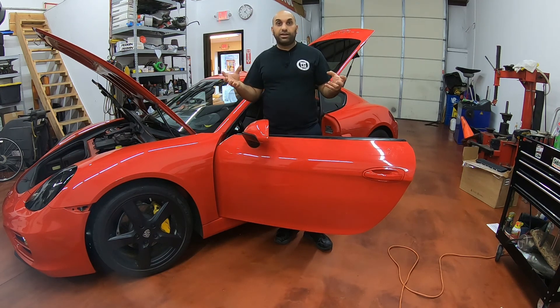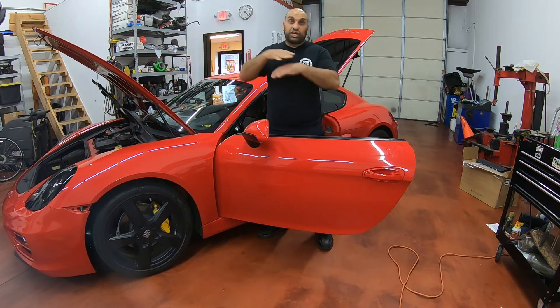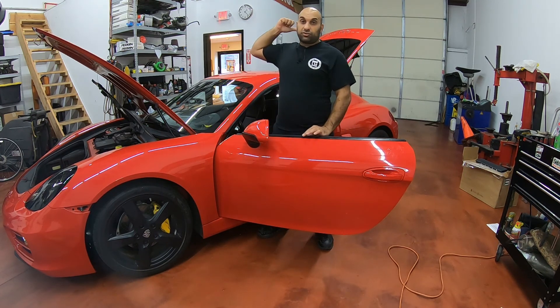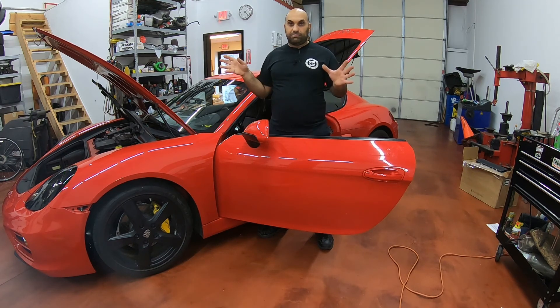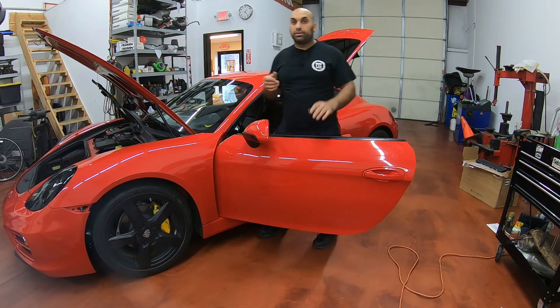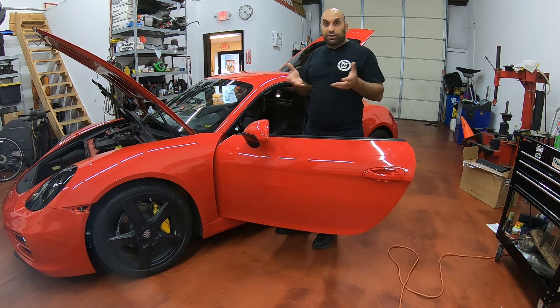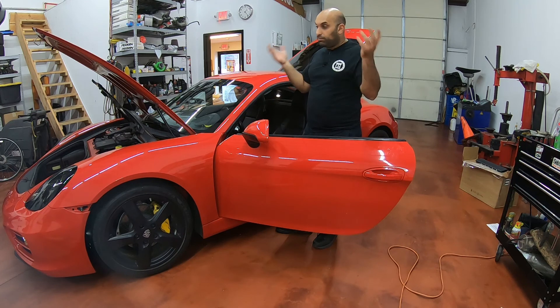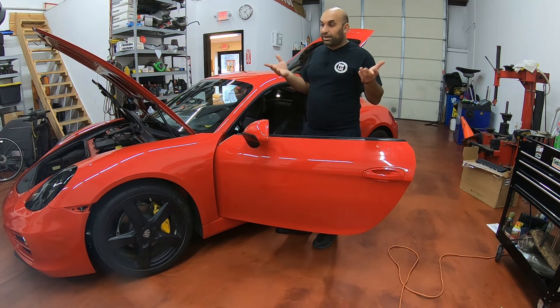I went crazy trying to find the problem. I found all the fuses and they were good — all the fuses in the driver side, passenger side, and under the hood were good. I was just checking all of them regardless. And in the trunk there was one missing. I mean, there are a few spots that are empty, but that was really the problem — it was just a missing fuse. I put a new fuse in and it solved the problem. The literature says the fuse is in the other location, not in the trunk. It's misleading and takes a long time. Diagnostics take a lot of time if the schematics are not accurate.